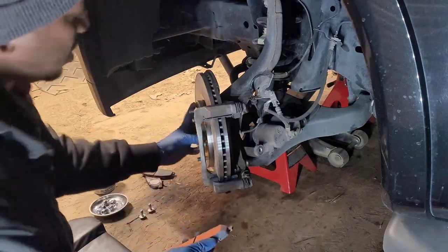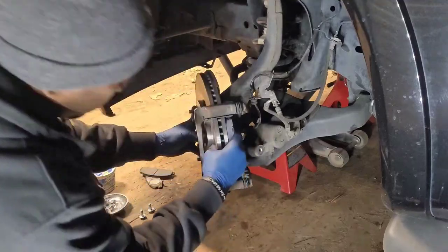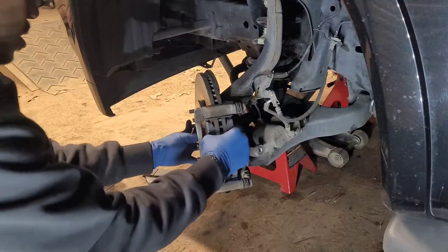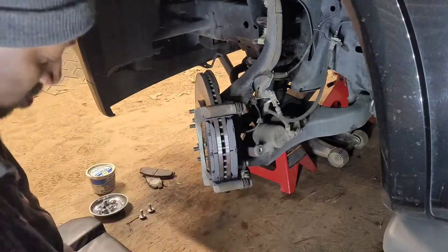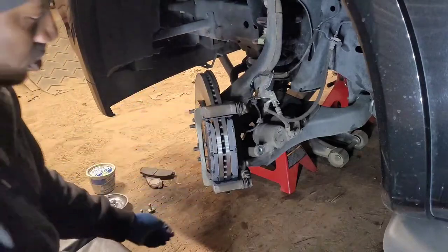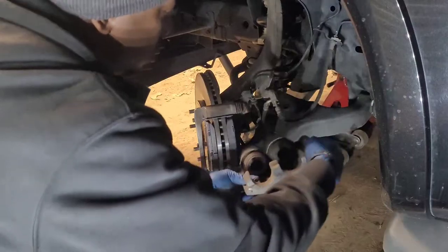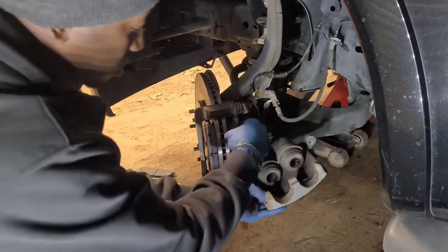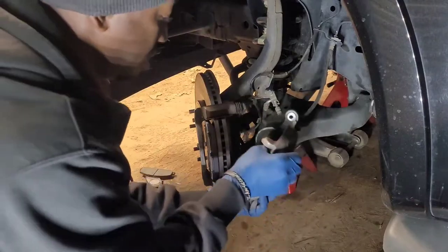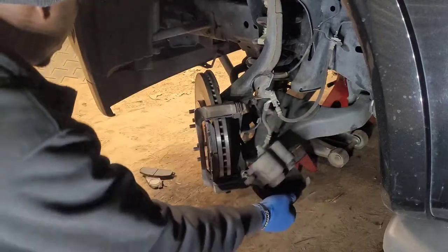I'm going to go ahead and get this done. But you just slide them back in the groove, same way the other ones came off. And then do the same here on the outboard pad. Inboard, outboard. All right. Now, before I put these clips on, I'm going to go ahead and work on squeezing the dual pistons. Matter of fact, let me move that because I know they're going to fall. I'll remember to put it back when it's time. But squeezing the dual pistons back inside the caliper itself.